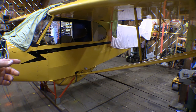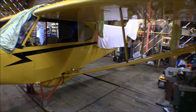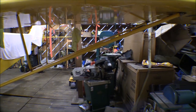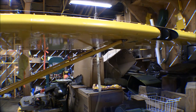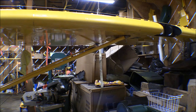So that wire comes through that pulley and then comes up through the fairleads on the forward strut. There are three fairleads — two large ones and one small one near the top — and it goes up around the pulley attached to the rear of the forward strut, then through the fabric of the wing and through another pulley on the other side, comes out the top of the wing, and gets attached to the aileron.